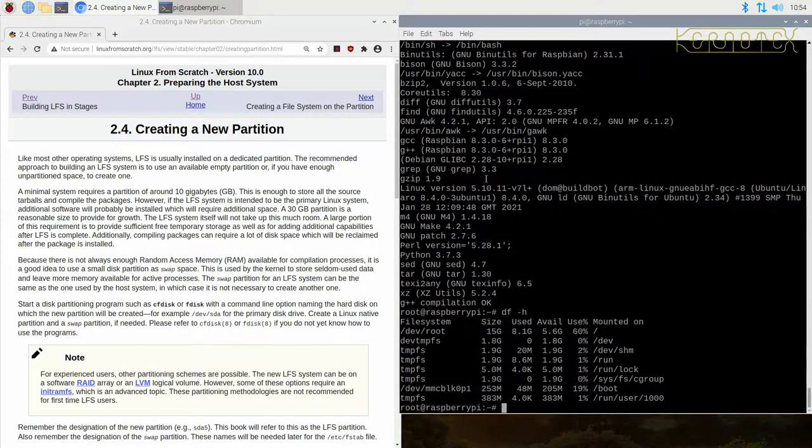What I'll be doing is installing it onto an external disk — it's actually a docking system with a laptop drive plugged in. I've done that because it's faster than the SD card. Because it will be on a separate external disk, I've got two options: I can either put the boot system on the disk with no need for the SD card at all, or I could keep the existing boot partition on the SD card and just modify it to choose between booting Raspberry Pi OS or pointing to the external disk.